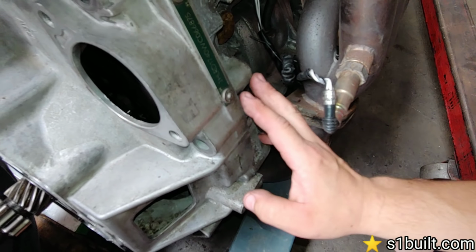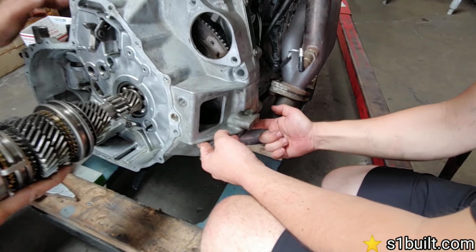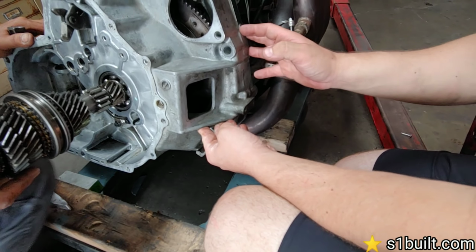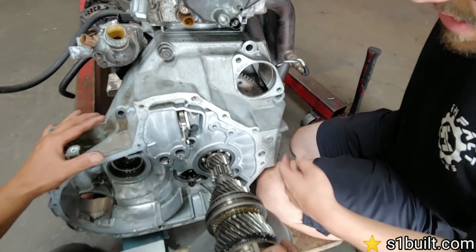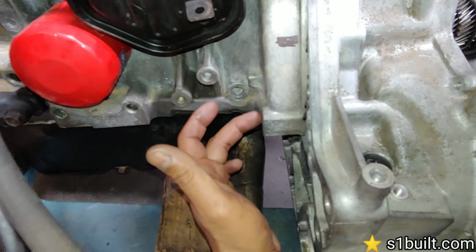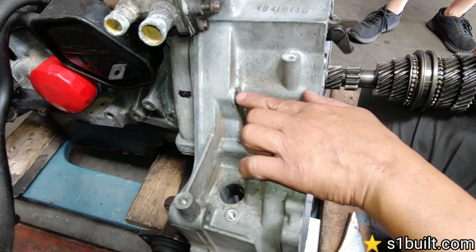This is the only one that we have to weld the block. We're gonna weld a piece onto the block and tap it so that we can thread a bolt in this way to the block. And then there's gonna be another one down here. So we're gonna try to build a bracket so that we can take it on and put it back off. The only parts are gonna be here, and on the other side. This one here we're gonna tap this bolt, this side here. Oh, right here, you're gonna tap into here? Yeah, this hole here. There's no hole here, so we're gonna drill this out more.